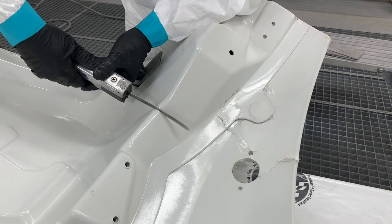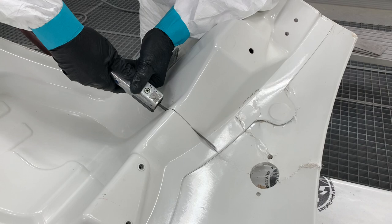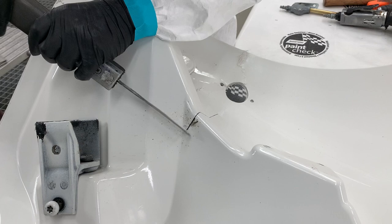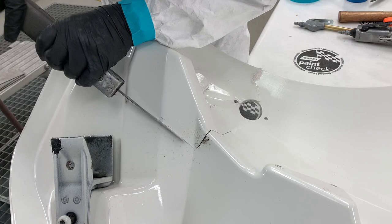Starting the repair with an air saw, I need to remove the inner panel. I've decided on cutting locations and am carefully cutting this inner brace without causing damage to anything else inside. Once the cuts are made, I'll use some heat to start separating the adhesive holding the inner panel on. In most cases you'd take the outer panel off and replace it, but the steps are very similar. We'll cut out this piece of inner panel to allow access, repair the outer, and then reinstall it — all shown here for demonstration purposes.